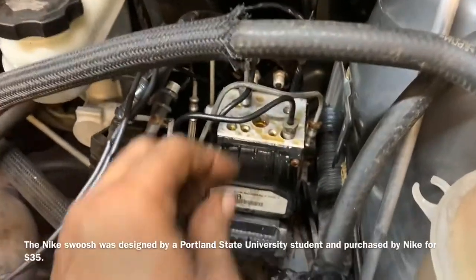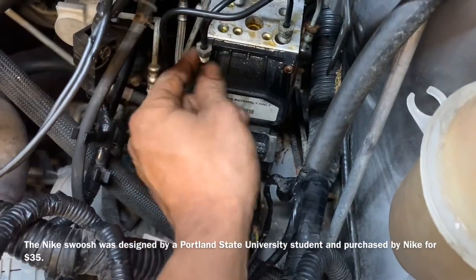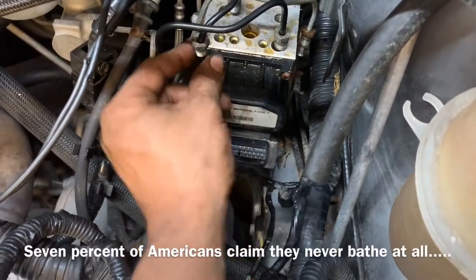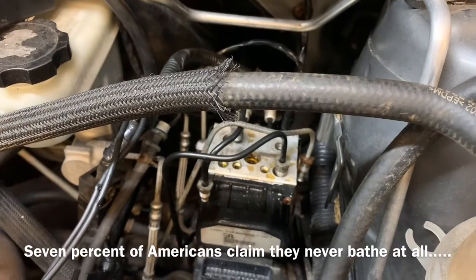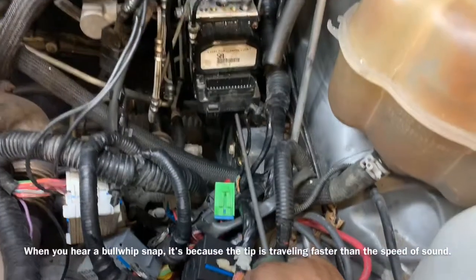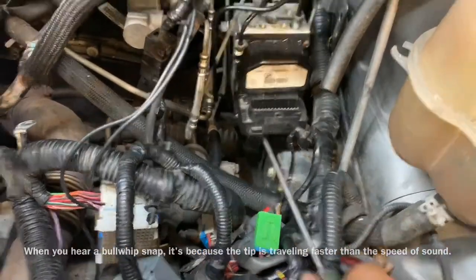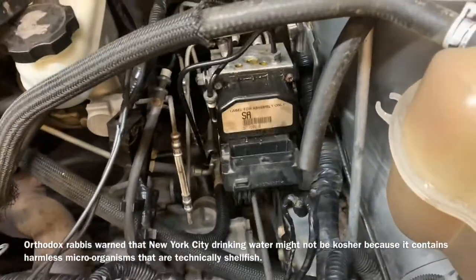I don't have much advice if your line nuts don't spin like mine do. Usually when I get them off, I take a socket and put it on the other side and spin it with an electric impact to loosen the lines up so they spin freely, because that makes the job a lot easier. I've got all the lines off, so I'm going to go ahead and remove the pump. I couldn't get mine to release from the bracket, so I'm going to take a screwdriver and hopefully wiggle it free. I did not have my nut as loose as I thought, so now that I've got it looser I can wiggle it up.